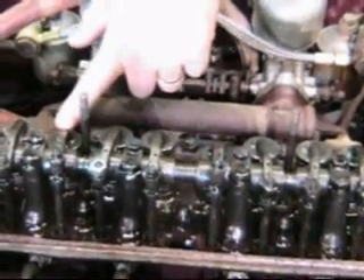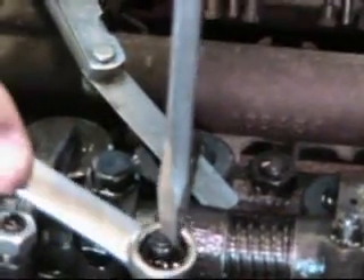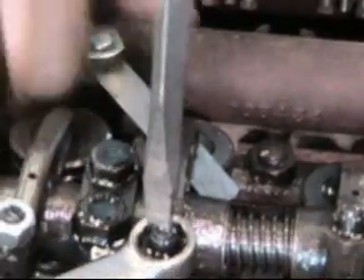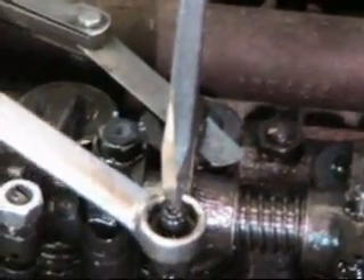And lastly, we bump our engine over once more. Two and five are open. The opposite of two is seven — adjust number seven. The opposite of five is four because four plus five equals nine. Now we'll go ahead and adjust our valves here. That's pretty good. And if we can go through and just quickly double check — always double check your work.